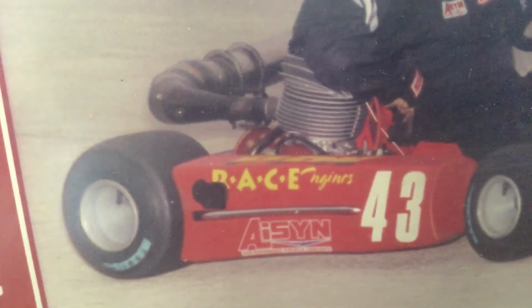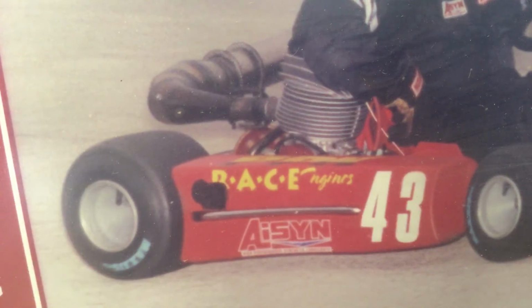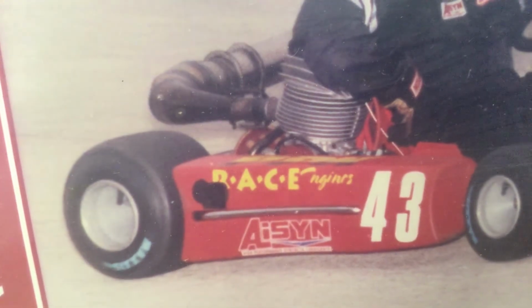Then we move on to the pinion, the bell gear. We are trying to run the biggest pinion gear, because that's what's going to give you the miles per hour. So you can carry the low gear on the end and then get your miles per hour out of your pinion, your bell gear. What you do is gear that bell to where, if you were on a tach, it would be banging out. Or when your motor goes kind of flat when you're running it hard, even though you're tuned perfect, that's where you want to be geared. Say five foot from where you want to end, it goes flat. That's where you want that pinion gear. Okay?